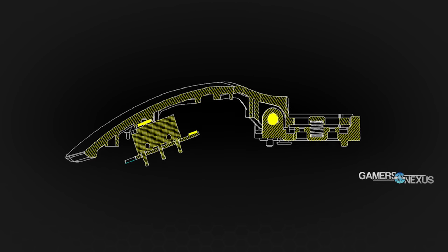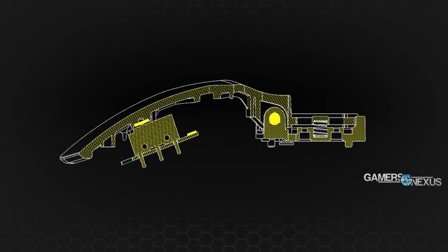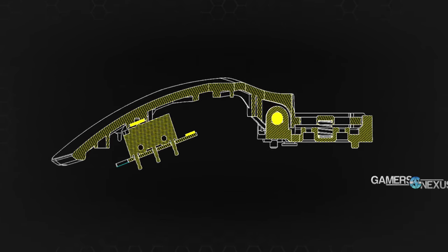With the G403, it fits really well and my fingers fall right into the center of buttons one and two. That's a good opportunity to talk about how the buttons work. With Logitech's G403 and G Pro, they have a sort of modified spring tension system similar to what you found in the G900. The G900 uses a mechanical pivot — a steel bar that sits atop a fulcrum and rotates to accommodate the key press.